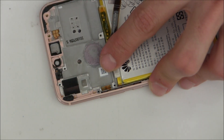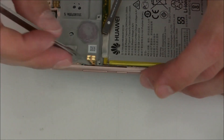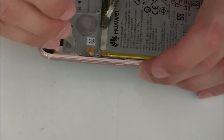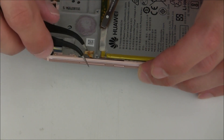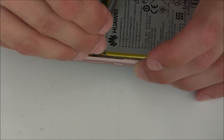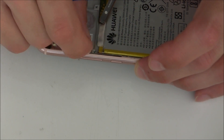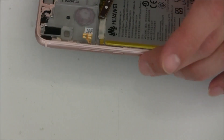The best is to work with these plastic tools — they're more convenient. Or use whatever tools you like and with the tools you have experience, of course. The flex cable is glued on the side frame, here on the side wall, so you will have to remove it. Now just be careful — don't break the buttons near the side wall, otherwise you will have to replace this flex cable. As you see, I'm having here some issues, so I'm heating up all the stuff here again.